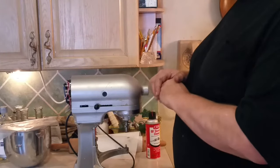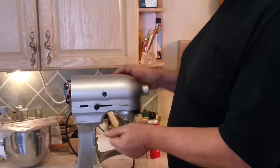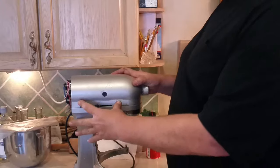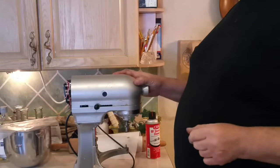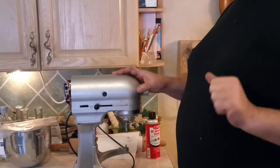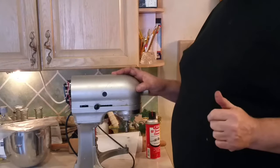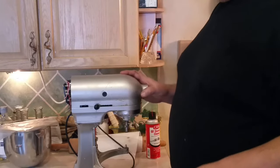The newer models are a little bit lighter-duty. Instead of having a solid-sealed unit with the screws that come up through the base, they have two screws located here and here on each side. They'll still have the same brushes, but won't have the same speed control mechanism. We'll cover servicing and replacing the speed control mechanisms in the next video. But today, we want to concentrate just on the brushes.